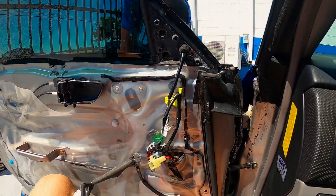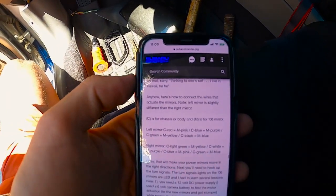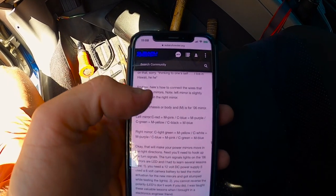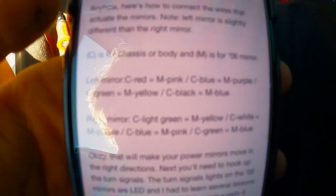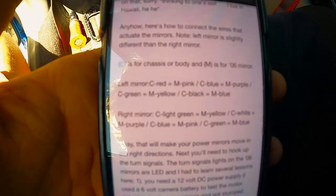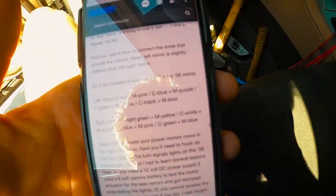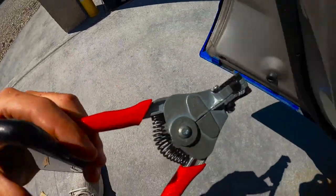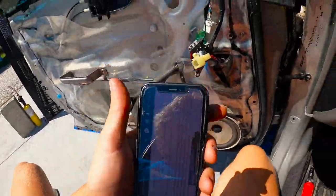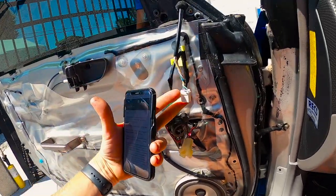So we got the new mirror on — it looks great. We're going to go ahead and use this site here. This is a forum from a while back, superforester.org — I'll put the link in the description. It basically just tells you which wires go to which wires on the chassis to the mirrors. We're going to go off of this and it should get our mirrors functioning properly. We're going to connect them using these little shrink connectors here, our crimp tool, and our splice tool. I'll go ahead and get those all crimped, spliced, and heat shrunk together.